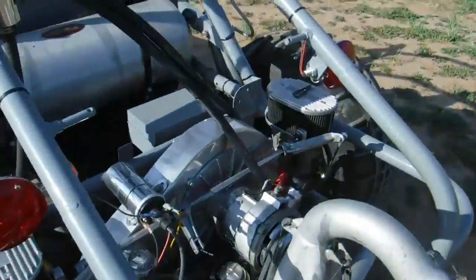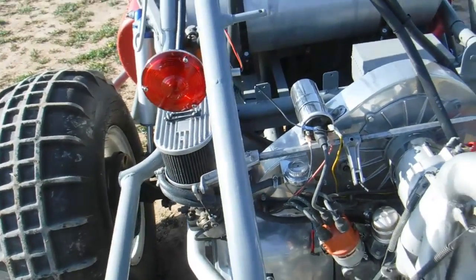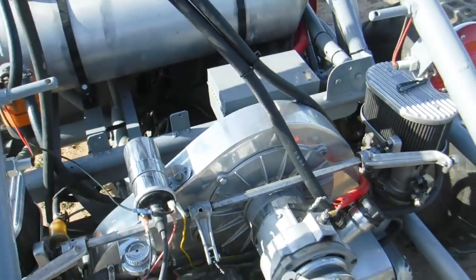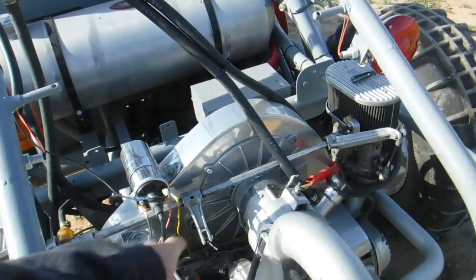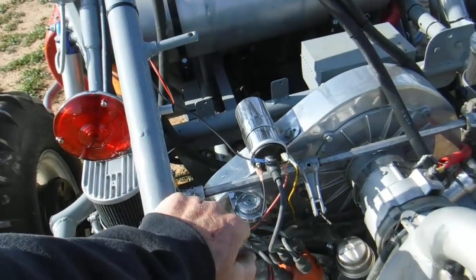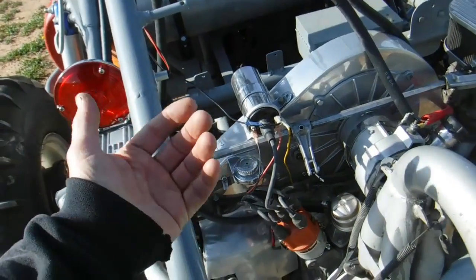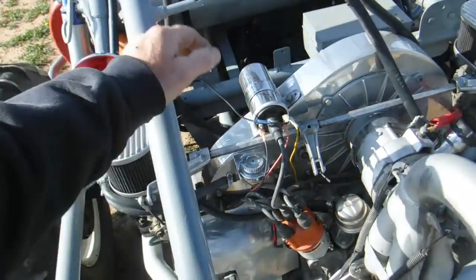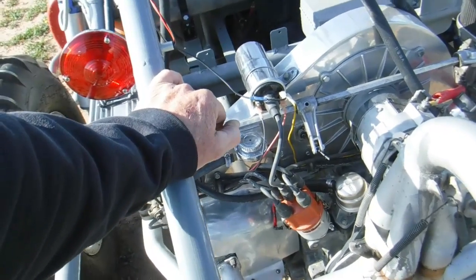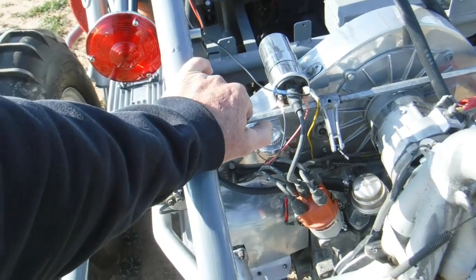What else have I done since Memorial weekend and my torsion bar setup? I took all the fan shroud off, lifted the alternator, took all the tin off, and the tops of the cylinders were just covered with mud and little stones and things that had gotten in from the desert situation. Some of that I may have blown up from the bottom at the car wash — I had taken it to the car wash about three times trying to clean all that junk off. If it's an air-cooled engine, you gotta have the air get to where it needs to cool.